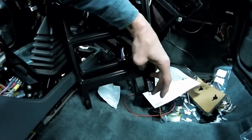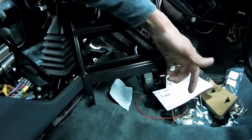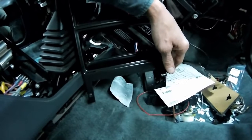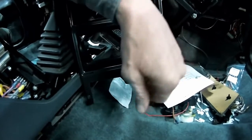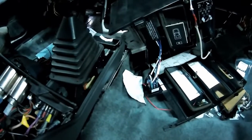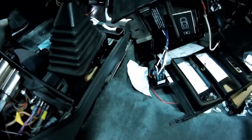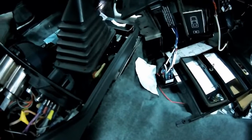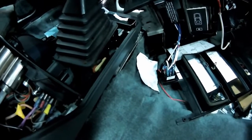What I have is a fuel pump auxiliary switch. When I arm it and turn it on it'll have a blue LED shining — it only works off the key, but it will run the fuel pump as long as that switch is on and the key is on. If you want to shut it off you just kick it off. What that does for me is allows the fuel pump to run continuously while I'm trying to start the car, otherwise your ASD relay will just run it for a second and if you don't have enough time to charge the fuel system you won't have enough fuel pressure to fire your injectors.